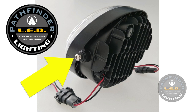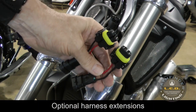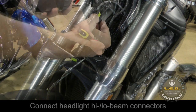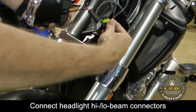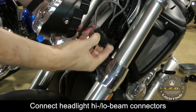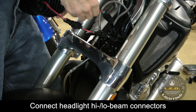You remove the bulbs from the socket by pressing in on the two tabs at the back of the socket. Your Pathfinder LED headlamp assembly comes with two chrome mounting screws — go ahead and remove these before proceeding. In your kit, you'll find two harness extensions. Go ahead and install these into the factory sockets, making sure the black wire on each extension lines up with the black wire on the factory harness. The wires coming from the back of the Pathfinder LED: you'll find the low beam on the left-hand side and the high beam on the right. Go ahead and connect these to the appropriate connectors on your V-Rod, making sure again that the black wires line up with the harness.